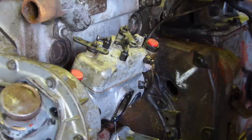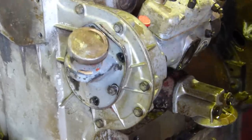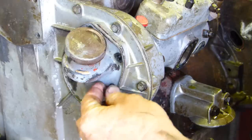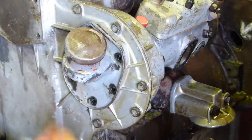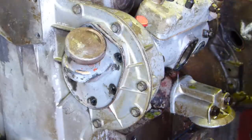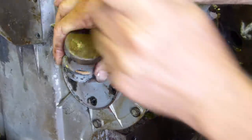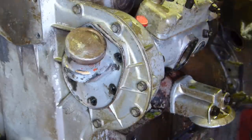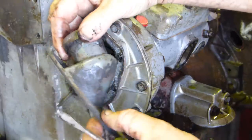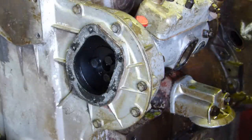We also need to come around the front here where the oil filler is. There's a plate on the front here that gives us access to the bolts that hold the pump on. Sometimes the radiator hose comes in real close around here. We've got the radiator out of this tractor at the time being, so hopefully we can film the whole lot for you nicely. That should just bump off - it's just a tin housing so don't go prying big bars into it and making it all uneven.